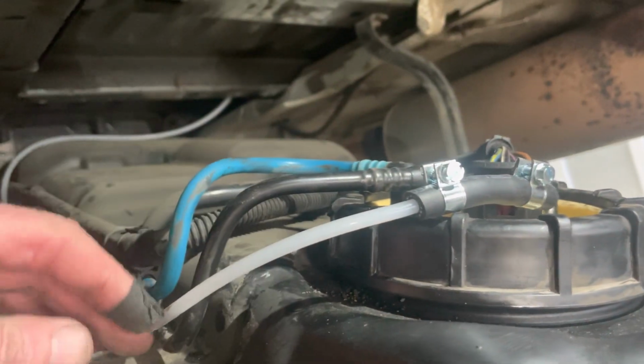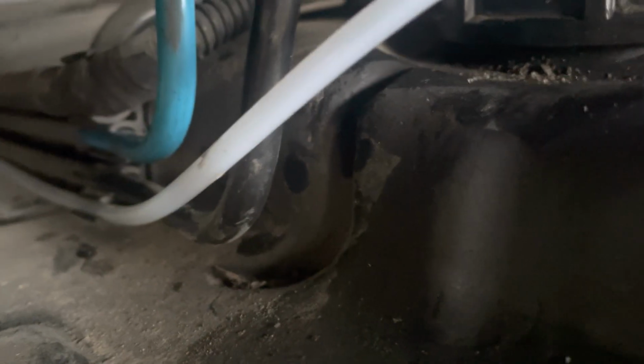Yeah. So we come down here. What we've done, put the pipes back in, white tube, and as you can see on the VW clip, where's the torch? Right. You can see there is actually a little clip at the bottom there on the VW clips that you can push the white tube into. So we've done the first one, done the second one, and then we took it over the top, and that is then going to the fuel pump.